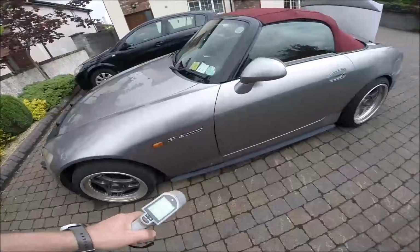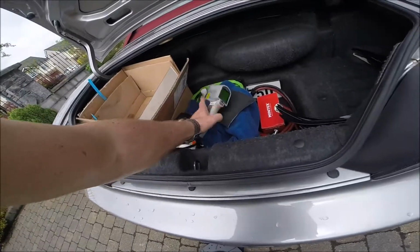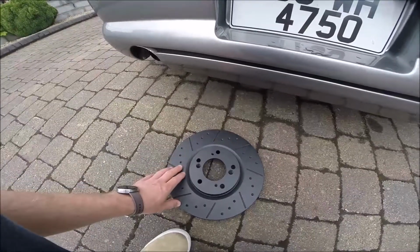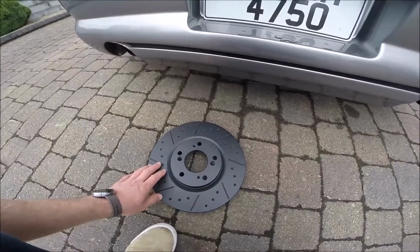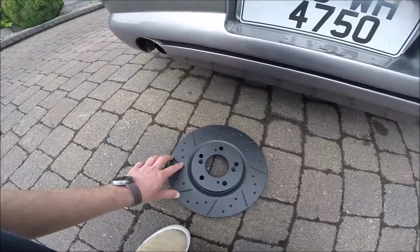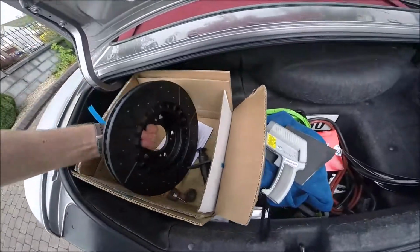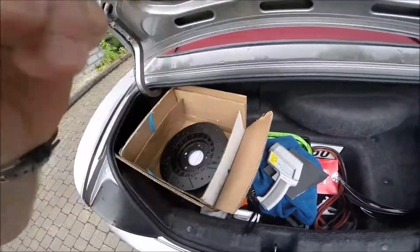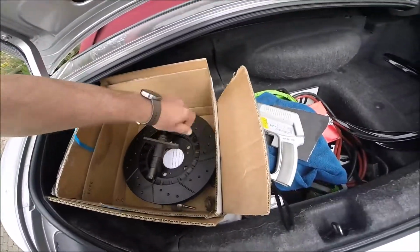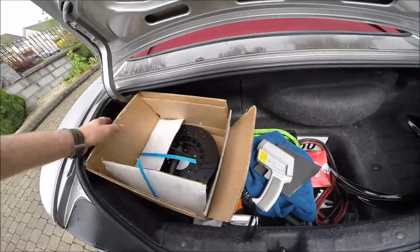Okay, so the idea is to do the spin braking on the cold brakes from 100 kilometers to 0. Check the temperature. Next run another 100 to 0, and we see how it will be on the warm disc temperature. I will not measure the distance because that depends on the tires and others. I'm just interested if the temperature will be different or not.